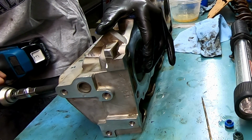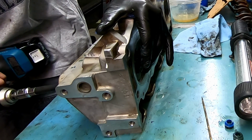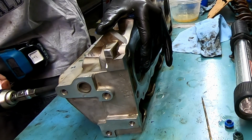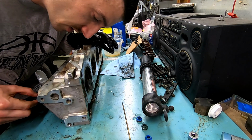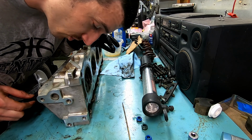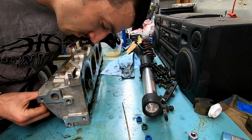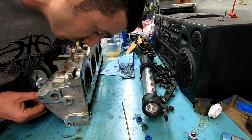Switch direction. Inspect it. Remember, the steel is much harder than the aluminum, of course, and this compound is just dramatically more aggressive on both of them. So you don't want to just sit here for a minute grinding away on full speed, because that'll take more than you need. I'm realistically playing it safe rather than sorry, and I probably could do a lot more.